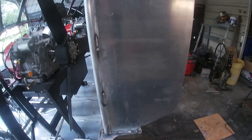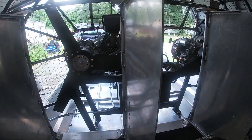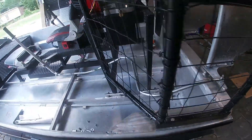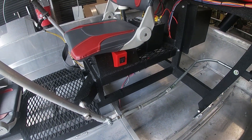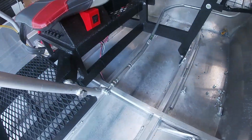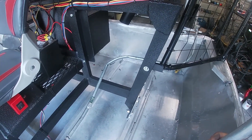This rudder with the bracket on it was made like it was intended to come on this side, but it wouldn't work because I didn't have the clearance with the prop that I needed. So what I did — I took it and moved it from where it belonged and put it on the other side. When I done that I had to brainstorm, taking some conduit and bending it all the way around and back over — only thing that happened with that was 100 percent fail. This thing will not work. So what I'm doing, they gave me a little arm that's going to fit on the back side. I'll get that in place and show y'all what I'm talking about — I'm going to get those other pieces made, I'll be right back.